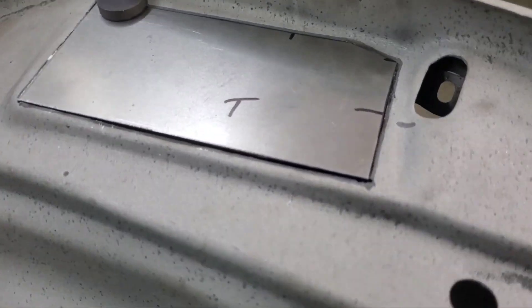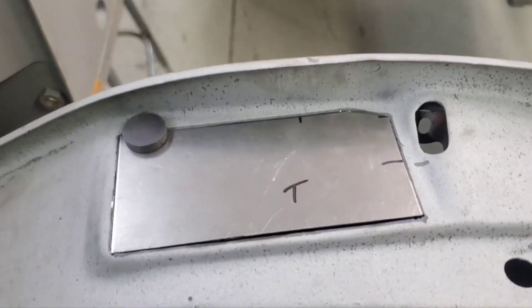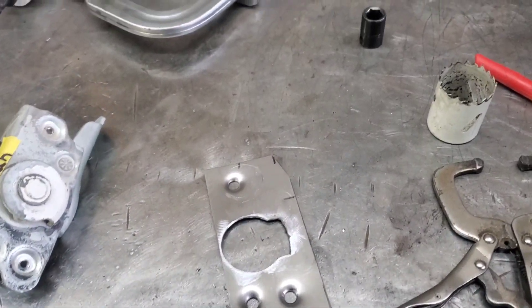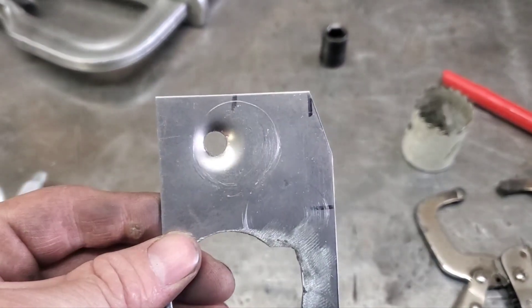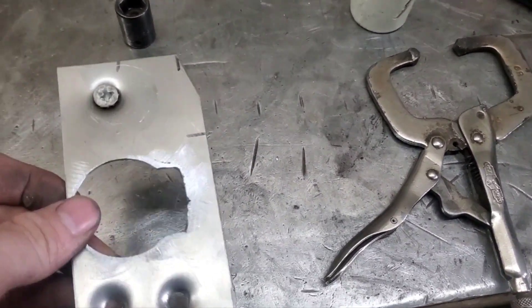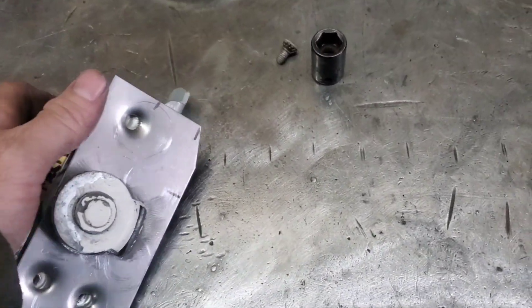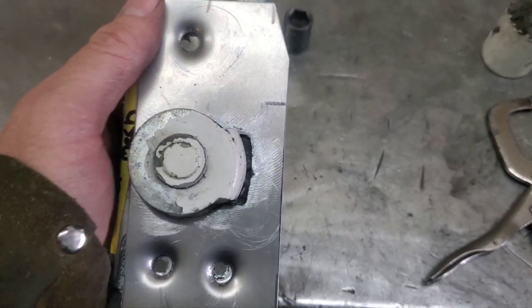You can see I got pretty close — I just need to kiss it with a disc. It's real critical that this piece stays about where it's supposed to be, because that's going to help with the door alignment and how well it closes. I use the original hardware to make the countersink. I just back it up with a heavy socket and put it in the press — doesn't have to be a very strong press, just enough to get that screw to settle down in there. It'll tighten up flush once you secure it. If you've got your latch, don't forget to test fit your holes, your lineup, everything — make sure you got room. Wiggle it around so you can make some adjustments.